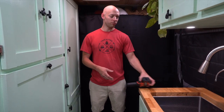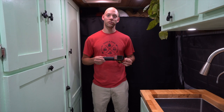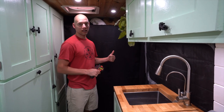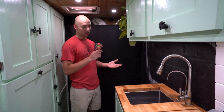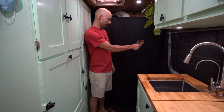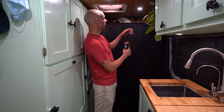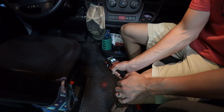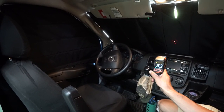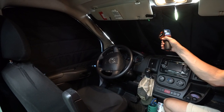It's 2 p.m. and 86 degrees outside. We've had the window covers up all day with the sun beating directly on them. We're going to take temperature samples in various locations using a laser thermometer — eight measurements throughout the cabin and cargo area. First measurement: 85.4°, second: 87°, third: 96.5°, ceiling: 96.5°. Then in the cab — floor: 87.9°, driver's seat: 92.8°, windshield: 102.2°, dash: 100.5°. Now let's take down the covers, wait an hour, and do it again.